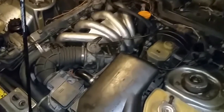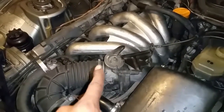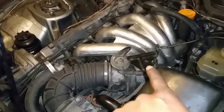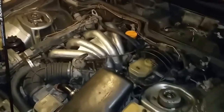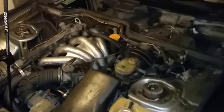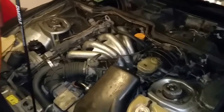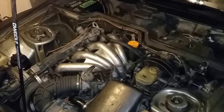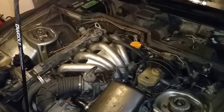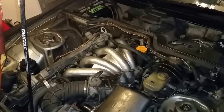I really think that once you get your idle speed, your air-fuel mixture, your linkage, and your vacuum setup all set correctly, you've really got it running in a really good way. I hope this video helps you out as you perform your own tasks or when you're troubleshooting idling performance and MPG issues with your 944. This is my '84. Hope that helps — stay tuned, thanks guys.